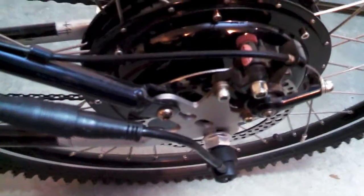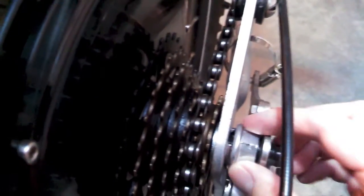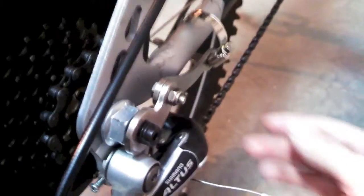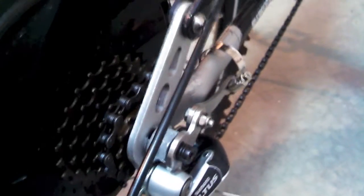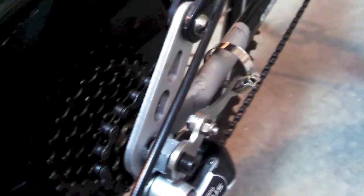I mentioned earlier that the washers were for a quick release, but they actually work great here. They slip on the ends and you can see I've got one right there. The reason it's great is that the dropout wasn't flush on the other side - the metal bends down - so the washer allows this to screw on flush. I also have the torque arm, which I still need to firm up, but luckily no spin-out yet.